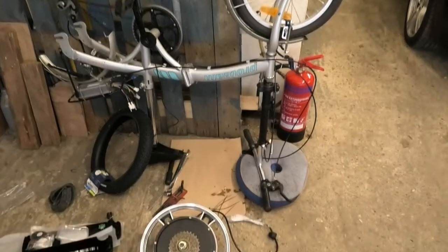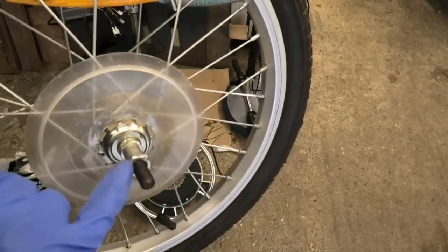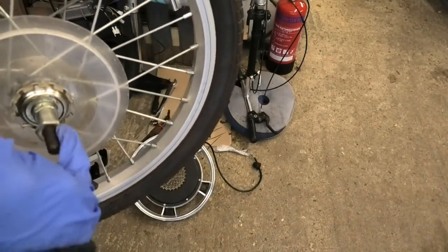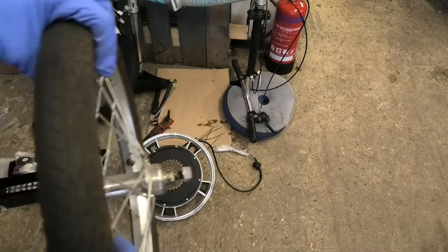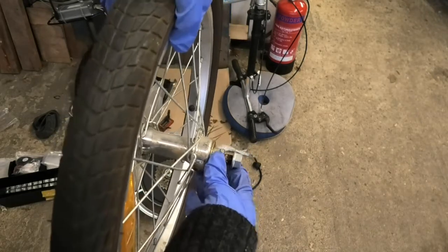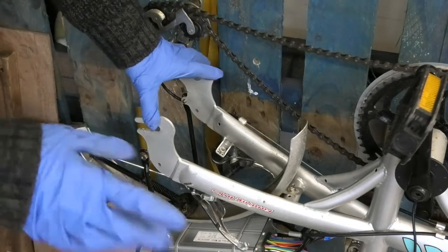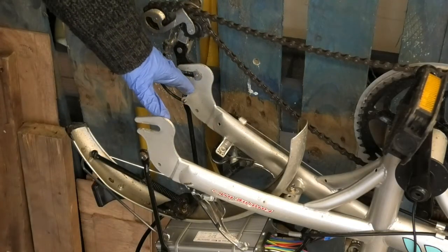One thing I noticed on this wheel compared to my original wheel is that this here is a little bit thinner. This bolt is skinnier than the one on that — the one on that is shaved on both sides, so it still fits. It fits the bike. It just about fitted when I tried to put it in this way. So the washers I'm given are quite thick, so the distance is quite important. What I did is, to get it to fit nicely, I just widened this a little bit — I opened it about five millimetres using a car jack that fits in there flat, and then you wind it and it opens this a little bit.